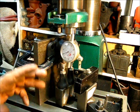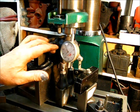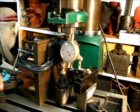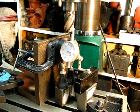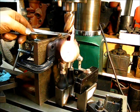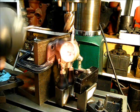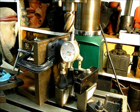That was chattery and rough feeling. When it smoothed out, it smoothed out at 50 thousandths. There was no reason to stop at 20 because it had an irregular feel to it. Now let's go a little clean up — that's 55 thousandths exactly. I'm going to stop right there and look down in there with the flashlight and the mirror. I can see it needs a little more — that's pretty good, but it's not 100%. So let's do it again.